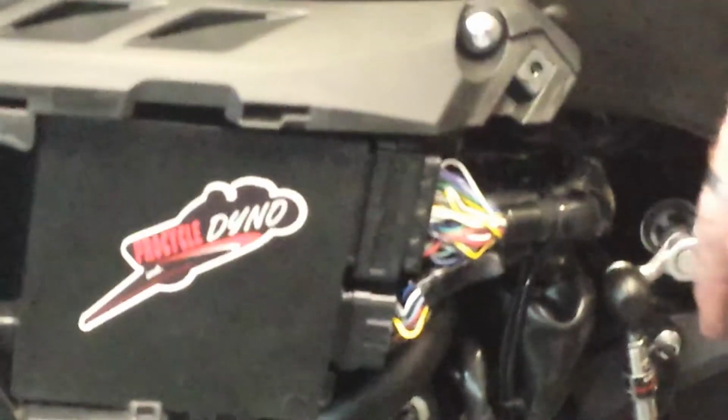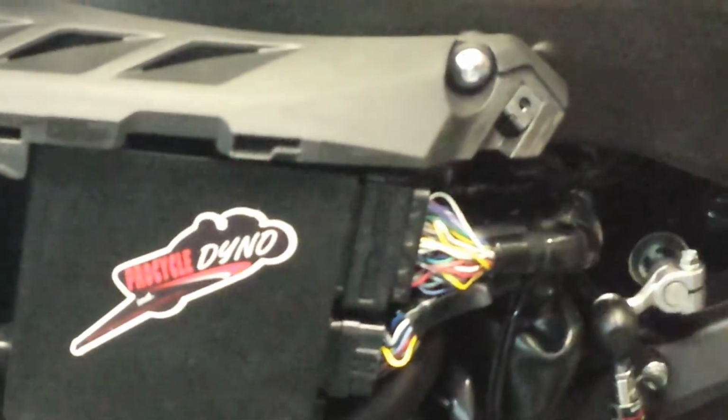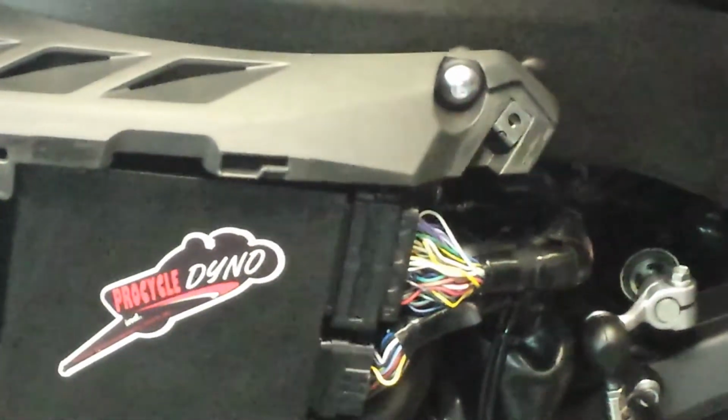All nice and neat. Now, when you turn the ECU on, there'll be a whole heap of fault codes. So you need to turn the ignition on your bike. That's just because when we bench flash something, we power the ECU up to write the ECU, but obviously we haven't got the main harness connected, so everything else that's connected to it will throw up a fault light.